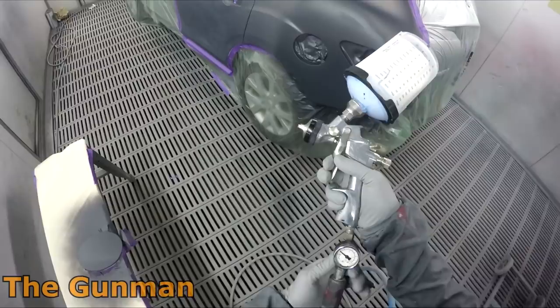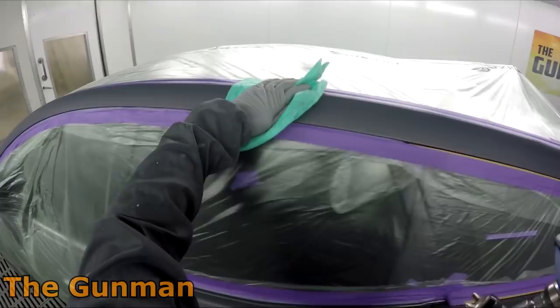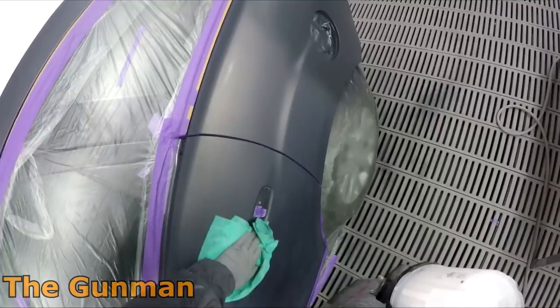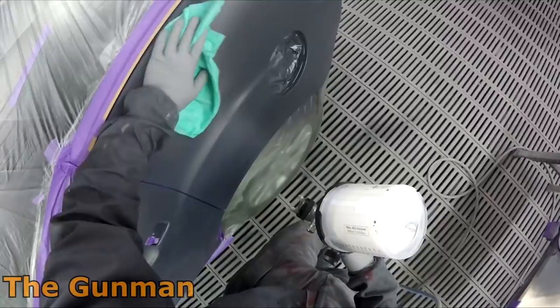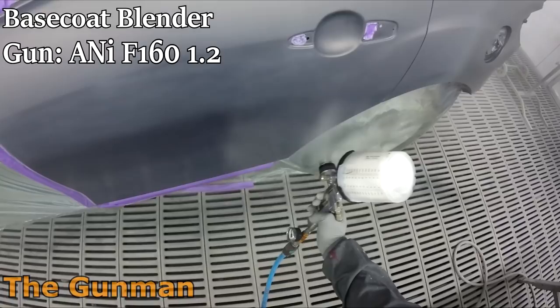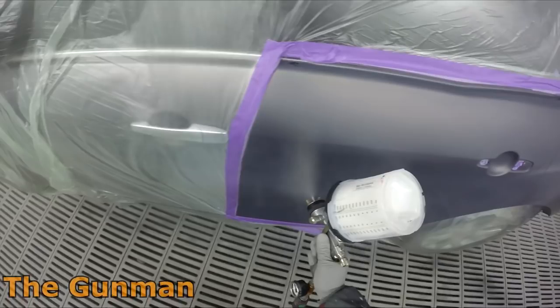This can only really go wrong if you use a fade-out thinner. Years ago a paint rep told me to try it under the name Promax Pro - I did it for about a month, then one time after baking the job, a big halo came all the way around the edge where I'd put the fade-out thinner right through to the final finish. I put it down to the fact that fade-out thinner has some acrylic or 1K clearing agent in it to stop it from drying - great for clear blends, but you really shouldn't use it underneath base coat color.